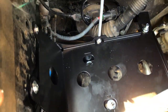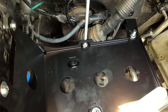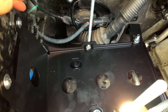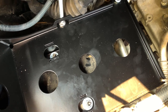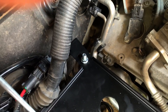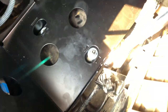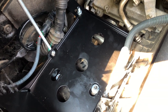Once you get all of that removed, there are two bolts that go on this side in factory areas. I put WD-40 in those holes to help put the bolts in easier — they were still kind of hard, but I live in Minnesota so there's salt and rust. You put two smaller bolts here, both 10 millimeters. Down in there are both half-inch with larger washers and larger nuts. In the back you're going to rotate up that bracket — that one is a 9/16th. Once you install all of those loosely, move it to right where you want it and then tighten it down. I ran that white-clipped large plug-in right behind there, and everything's tightened down.